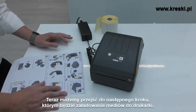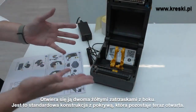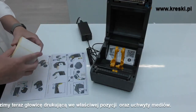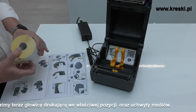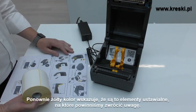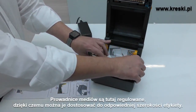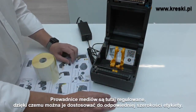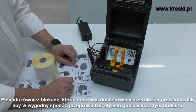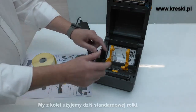The next step, we're going to load some media into the printer. Open it up with the two yellow touch points on the side. The standard clamshell design folds up and stays open. You can see the print head there in the position you'd expect, and the media guides are there. Yellow indicates these are things you're meant to touch. The media guides are adjustable — you can open them as far as you need for the media; they're spring-loaded and return. They also have a lock on them, so if you're using fan fold media supplied externally, you can lock the guides into position.